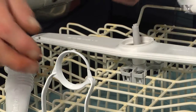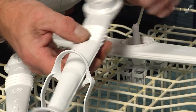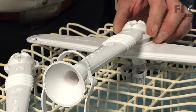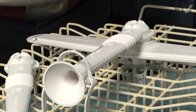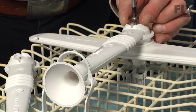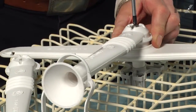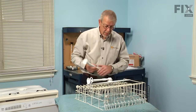Take our new tube, slide it into place. There's a little notch on that center bearing that will line up with a notch in the internal portion of the tube. We'll slide that down until it's engaged, and we'll replace that Phillips screw. Make sure it's tight, and our spray arm still turns.